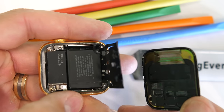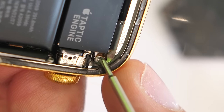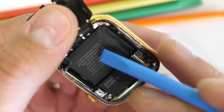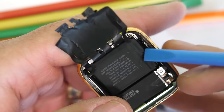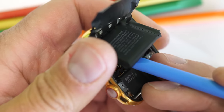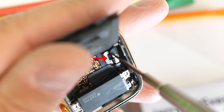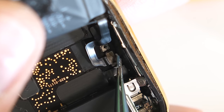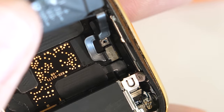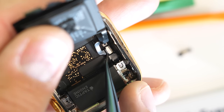It was under about 10 or 15 feet of water — you'll have to check out Jake's video to see exactly how deep. At first glance, this watch is still surprisingly clean with only a little bit of rust and corrosion around one screw and a few other places. The tiny 291 milliamp hour battery, about as big as my thumbnail, needs to be pried out. All of these screws are tri-points. When a phone or electronic device is water damaged, it's usually the battery or the ribbon connectors that stop working first — a phone won't turn on if the battery is dead, and also won't function if the connections are corroded.